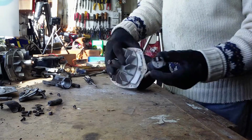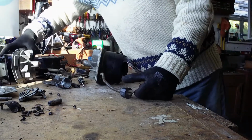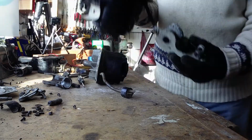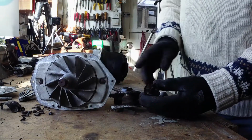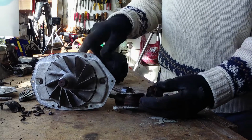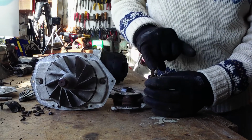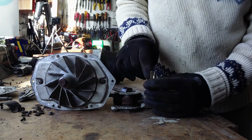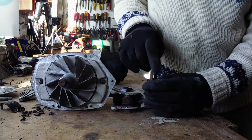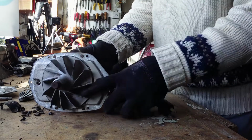on because it's a 2-wire machine or a single speed one, whereas this one here has got 3 pins on it because that's a 3-wire machine. A lot of them were converted to 2-wire eventually, but that one is a 2-speed one. You've got to be careful to get the right one for the neutral. It's not the black one, that's the neutral, the yellow one, and the other 2 colours are for the 2 field windings for the different speeds, but I'll show you that in a bit.